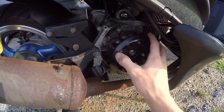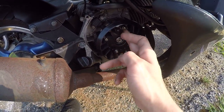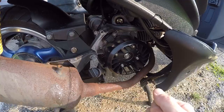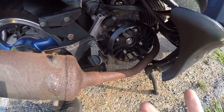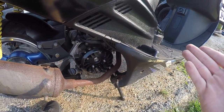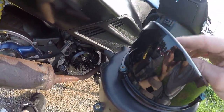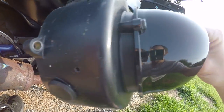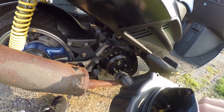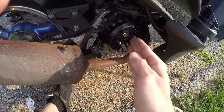That's gonna be it for the cooling fan install basically. All you gotta do — if you're feeling nervous about it, you can put some blue loctite on the beginning of the bolts, hand start them, put them down a little over hand tight, and then put your two 8 millimeter fan shroud screws in. You could loctite those if you want. Also, if you are running plastics, keep the plastics on — the plastics help keep it cool as part of what helps this work better, if it does actually work the way it says it does.